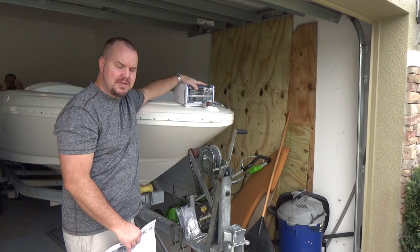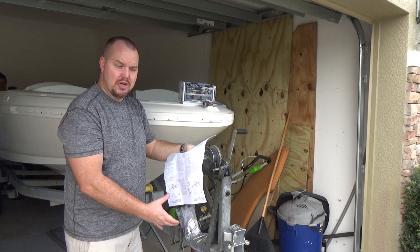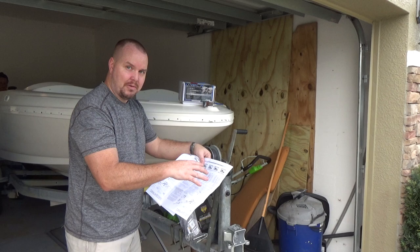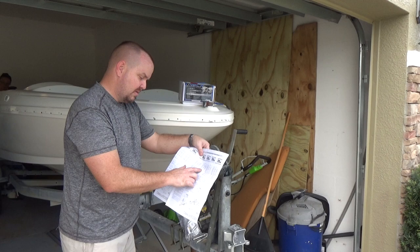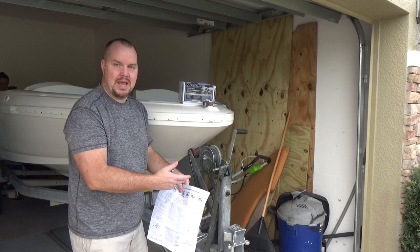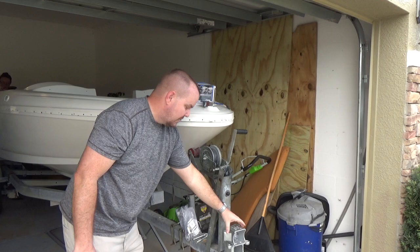When you open the box of this trailer folding hitch kit, you get good instructions. I got the three-by-three size. It tells you how much tongue to cut off and how much weight you can put on the tongue. We're going to cut about 27 to 30 inches, which takes us down to a 400-pound tongue weight — and the tongue weight on this boat I can lift with one hand, so no problems.